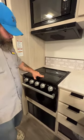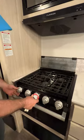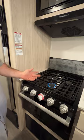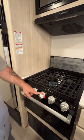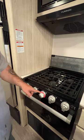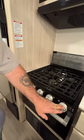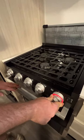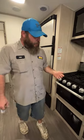Next we've got the stove. Whenever you go to light it, you're going to turn the knob to the flame icon, then turn and spark ignite. It lights up the knob indicator to let you know a burner has been turned on — that's a really nice feature. Your spark igniter will also light your oven with the same concept: turn it to the flame icon, but you've got to push and hold it in while you spark ignite. Once it's lit, hold that in for about seven to ten seconds and then set your temperature.